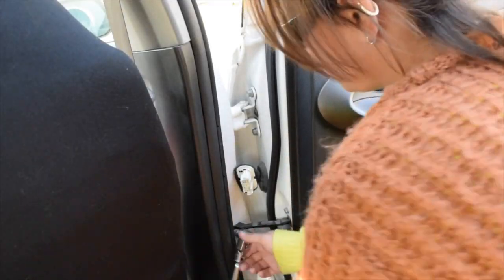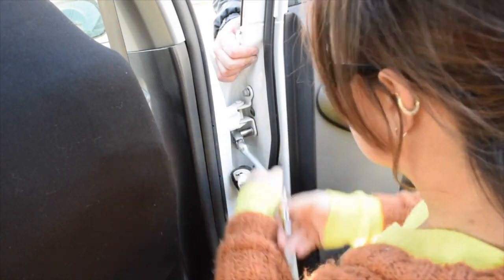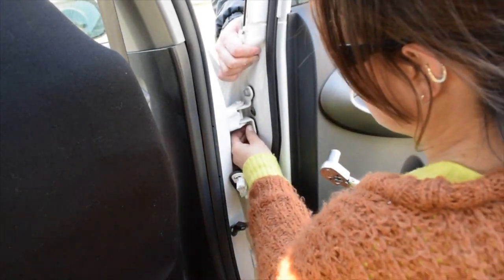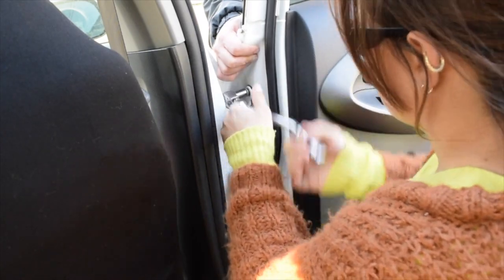So like I said I used 12mm and I loosened all the bolts. Then I took a 10mm and I loosened the bolts on the little hinge part that comes out of the door. You only want to loosen these — you still want to leave them connected a little bit just because you're going to need someone to hold the door while you take them out completely.